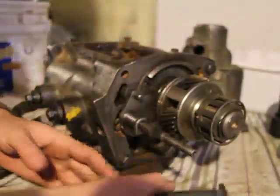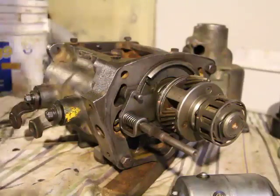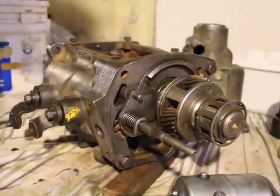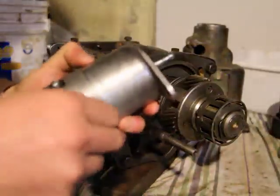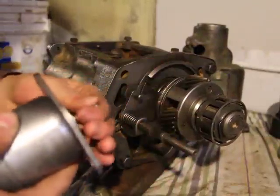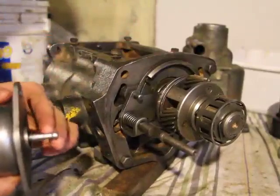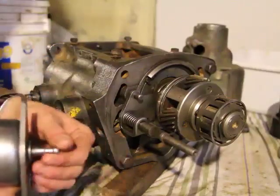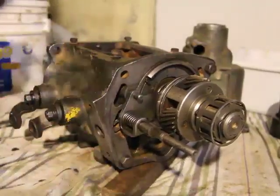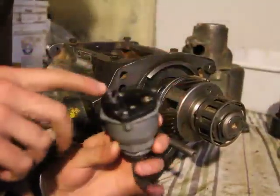Now I might give you a quick demonstration. The advantage of using the battery charger is that it's low amperage, so it's unlikely that it will damage anything if you mess something up. But because of the low amperage, you might just have to give it a push or a pull. It might not come. All this does, so that we can continue with how this works on the transmission, is go forward and backward, just a little piston, forward and backward. That's all. Now the other terminal, the one with the point, would be connected to a point here on this device, the governor. And here you can see two wires.